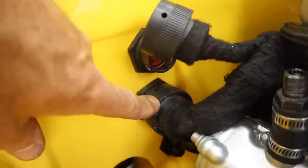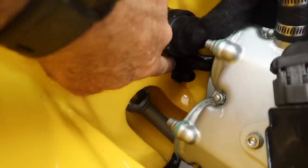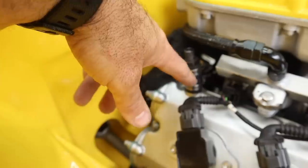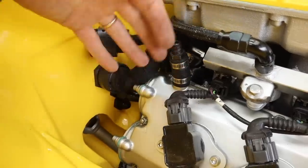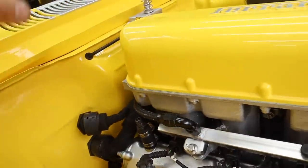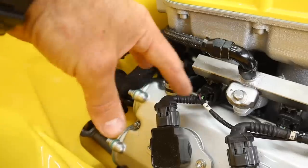The back half of this top bulkhead connector isn't actually pinned yet — I haven't wired that one up. The bottom one is wired to the ECU; the top one has most of the power and the heavier connections. Down underneath those are two bulkhead connectors going to my dry sump tanks — one is the breather return, and the other has to go from the PCVs. For those who don't understand, that's Positive Crankcase Ventilation — basically if any gases leak past the rings, the crankcase builds up pressure, so you need to release those gases via a one-way valve. The oil vapor goes back into the dry sump tank and recirculates through the engine. We're looking at taking another car's factory PCV and joining these two lines together, connecting them into the dry sump tank.